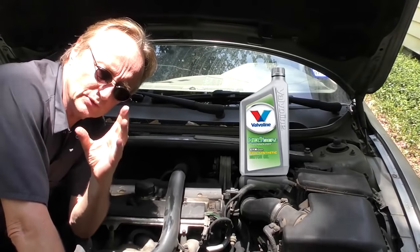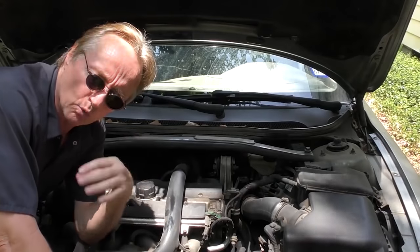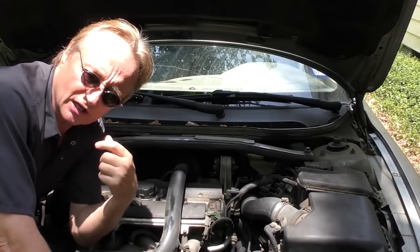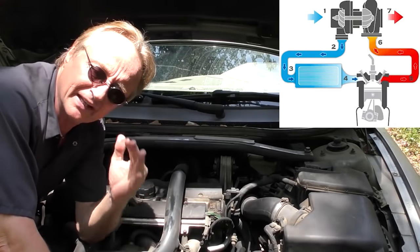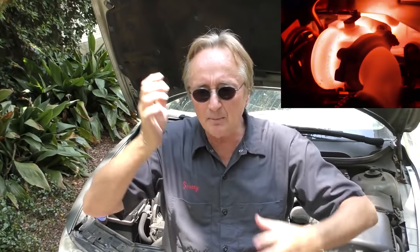The third oil-related tip: use high-quality oil and change it frequently. Full synthetic oil is best because it works under higher temperatures, and the turbocharger uses hot exhaust gas to spin itself - it gets super hot. If you have a turbocharged car, definitely use full synthetic oil and change it every 5,000 to 7,000 miles. Also, if you've been driving hard with the turbo - some turbos almost glow from the heat - when you come to a stop and shut the engine off, wait about 30 seconds so oil and coolant can continue flowing through it to dissipate the built-up heat.